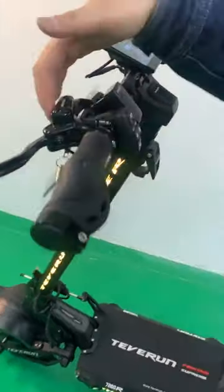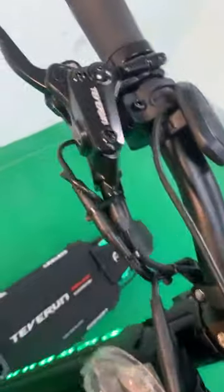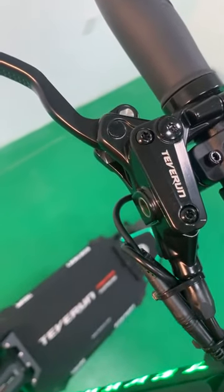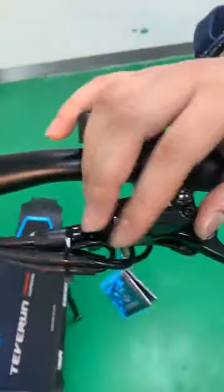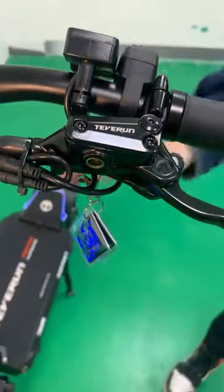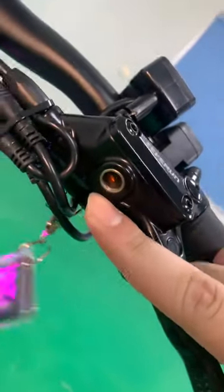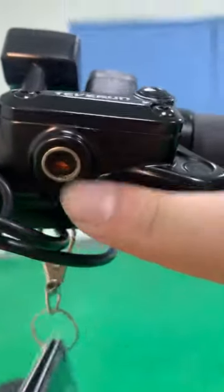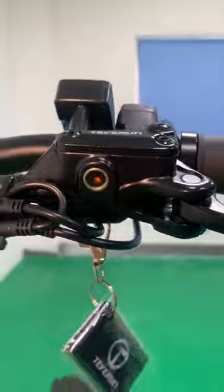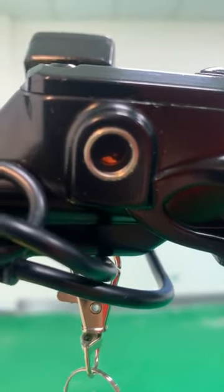The real highlight, however, is the four-piston hydraulic brake, which we are using for the first time on our new models. When you press the brake at high speed, the feedback will be faster and more pronounced. With E-ABS, the whole brake system's efficiency is greatly improved. There is a transparent circle that enables you to monitor the brake oil level right here — when it's full of oil, you cannot see the horizontal line, but when the oil level is low, you can see it.